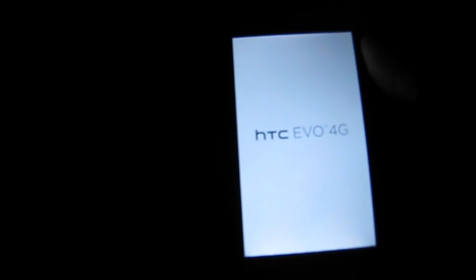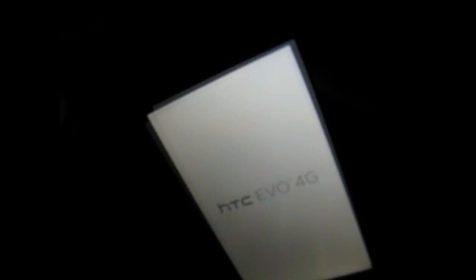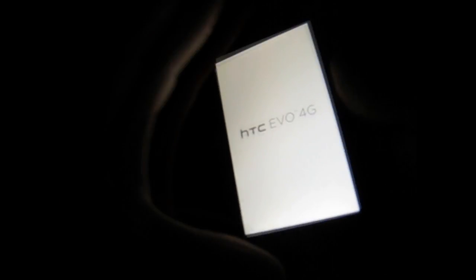It's going into bootloader so I can get into the recovery. Remember guys, that's by holding the power button with the volume down button on your HTC Evo. Once you get to the bootloader, go down using your volume and power buttons to the recovery option, which is in green, and just hit the power button.